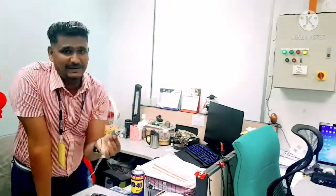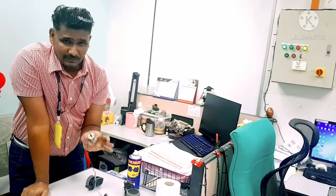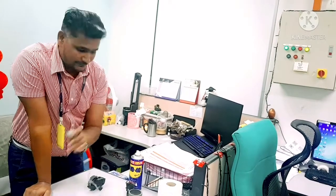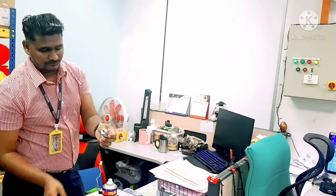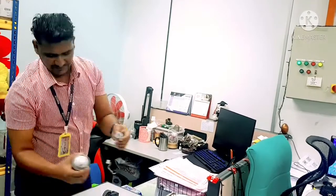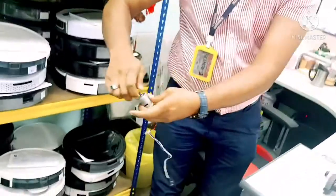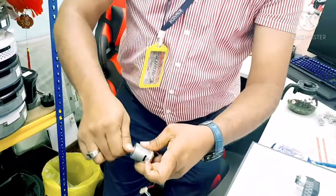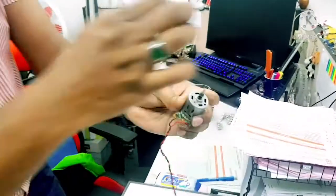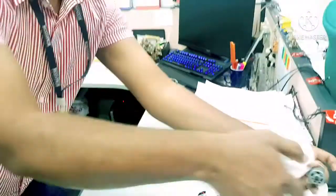This is one thing I want to let you know — if you use this method at home, this is not a permanent solution, only temporary. After maybe one or two weeks you may face this problem again. But if the motor is slightly jammed, you can spray WD-40 at the sides of the motor two or three times, then turn it harder two or three times. Before the treatment it was very hard to turn, but now after spraying, the motor turns easily and normally again.